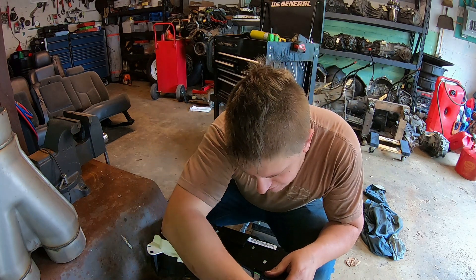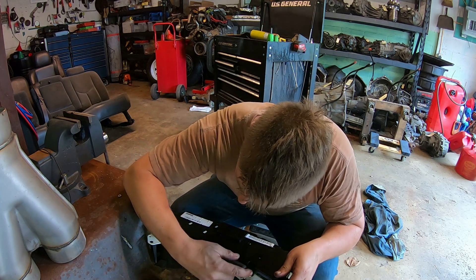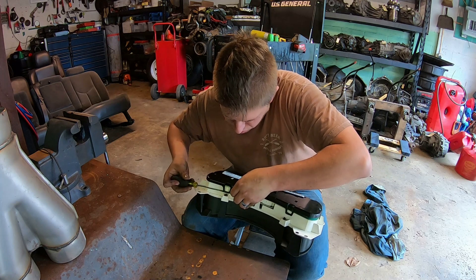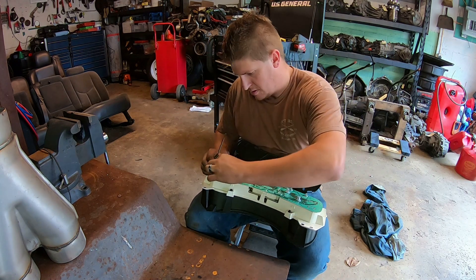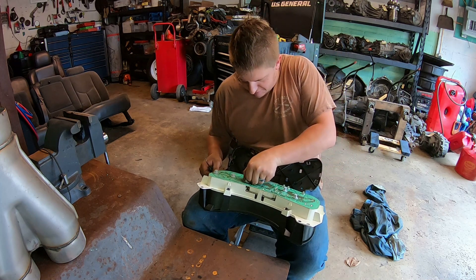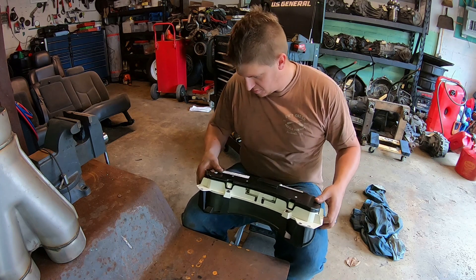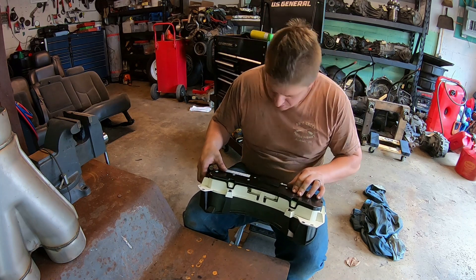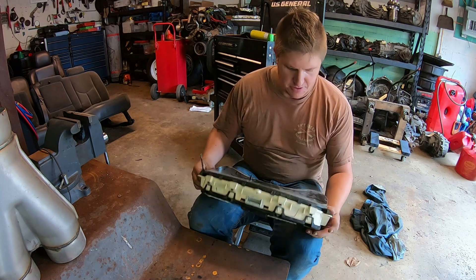I screwed up — I've got to take the back off. Now all these need to be nice and vertical because this rear cover actually kind of acts as a lock to hold them in place. There we go. That should have all of those bulbs working now, and all the gauges already worked.